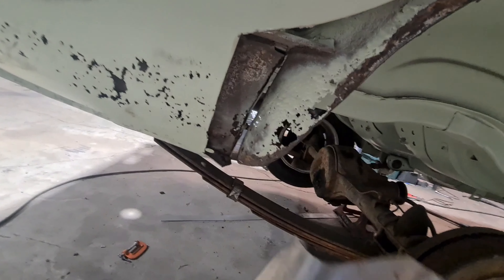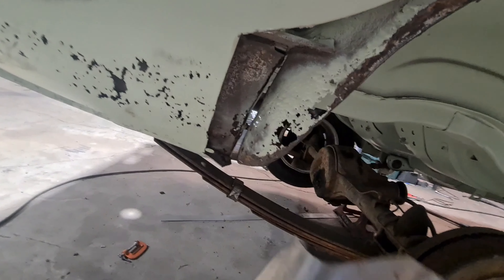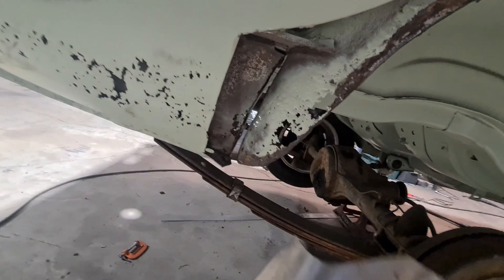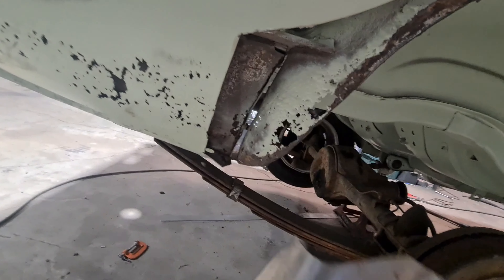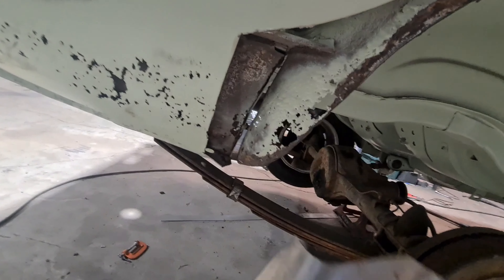Pretty happy with that for the time it took. There's the edge I was talking about on the bottom of the guard — it's stretched and all bunched up everywhere, so I'll put it in the kick shrinker to get that edge back straight. The inner isn't bad — I've just got a patch here on the edge and a little one in the corner, and then I looked up and it's just a mess. I have to remake this section. I should have known — I did see a little bit of pitting on the floor. This is what it looks like when you get a car blasted: what looks like a small hole that's been treated is always hiding worse underneath.